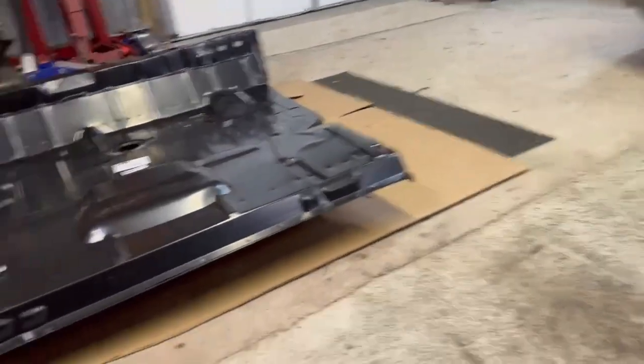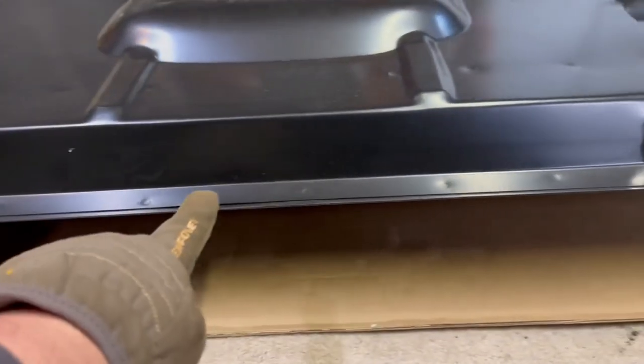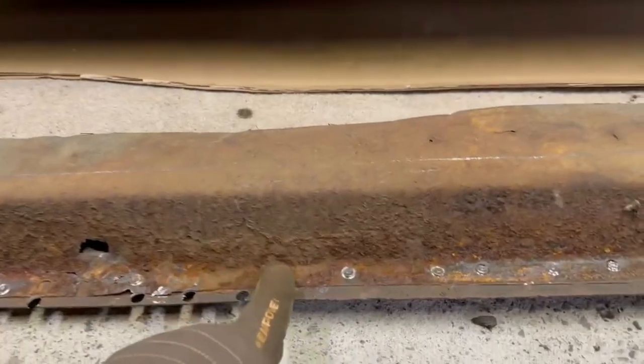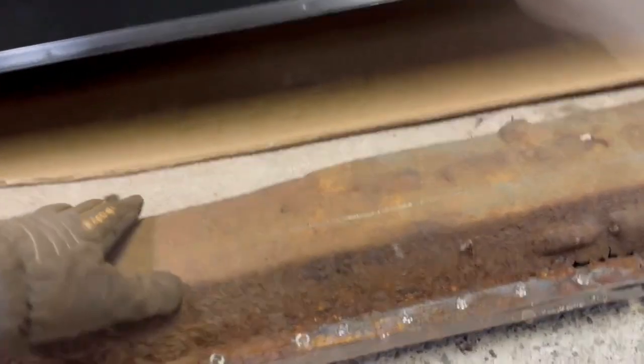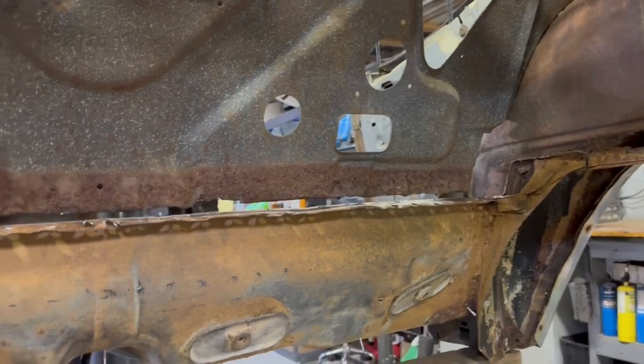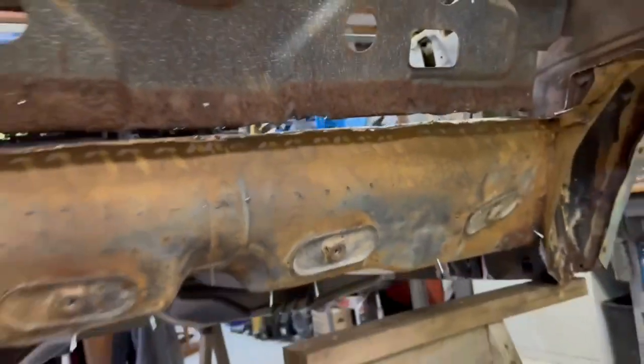Let me show everybody what this piece looks like — this is the new trunk floor assembly and this is the front of it. This tab right here is the tab that goes between the rear seat backing and the rear seat under-seat floor. Obviously these bases sit on top of the frame of the car — that cannot be. It came out with a pretty significant amount of reluctance. I wore out two maybe three spot weld drill bits and had to split it with a chisel and pry it apart. There you have it — that's today's progress.